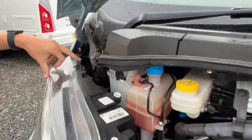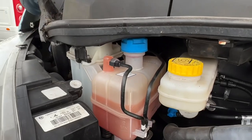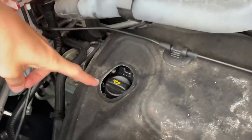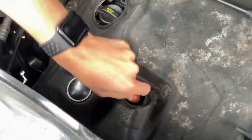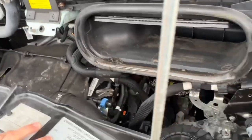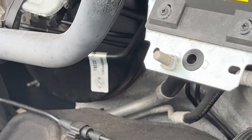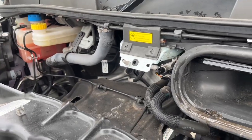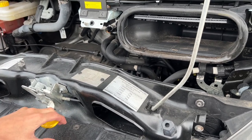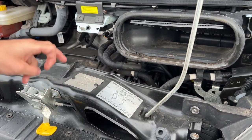So you've got all your fluids — the main one being the screen wash. You can move the covers by lifting the tabs, and you've got power steering fluid, coolant, and brake fluid, oil filler, and a dipstick for checking the engine oil levels. Paint codes are on this sticker here. Weight plates: 3.3 tonne gross vehicle weight, which is the 115. The train weight is 5,300, so 5.3 tonnes if you were to put a tow bar on — meaning you can tow up to two tonnes behind the motorhome, but you can't exceed that. You've got a unique build number and your SGE number, so if you ever need any parts, quote that number.